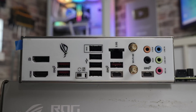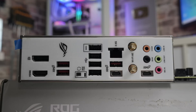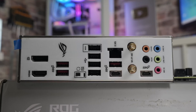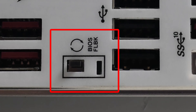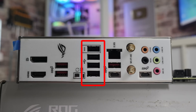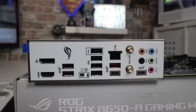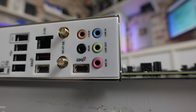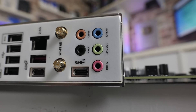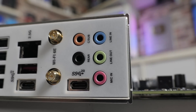Let's move around to the rear panel. There's a DisplayPort and also HDMI — so if you're using a CPU with integrated graphics, the DisplayPort is 1.4 supporting up to 8K 60Hz, and the HDMI supports up to 4K 60Hz. There's a pair of super-speed USB ports at 10 gigabit per second. Then the BIOS flashback button and LED. There's a bank of four USB 2.0 ports with the top one for BIOS flashback. Then Intel 2.5 gigabit Ethernet — a nice Intel setup. Another two super-speed ports: a USB Type-A and USB Type-C, both 10 gigabit per second. Then the Wi-Fi 6E antenna connectors. Finally, a USB Gen 2x2 Type-C at 20 gigabit per second — the fastest port on the back — and all your audio input and output jacks.